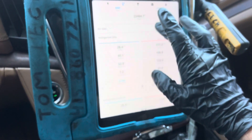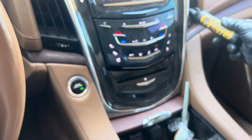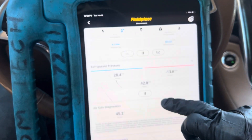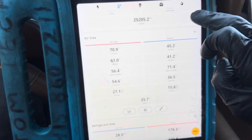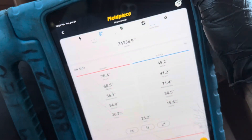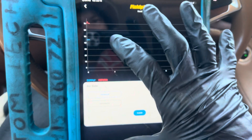I just lost my airside link tools — okay, let's link back up again. There we go, we're hooked up. At idle, sitting in the sun, we're at 45.2 degrees at the front ducts. There's the rear two — remember those rear blowers at the top — you have to record those two as well. I'm data logging this for the customer so it goes straight to the work order.